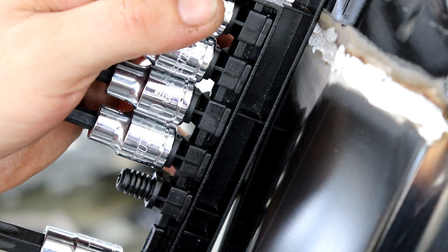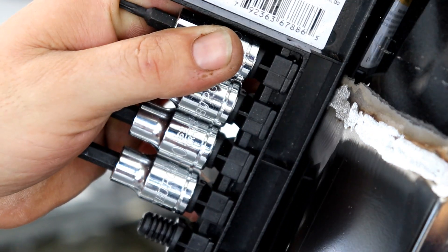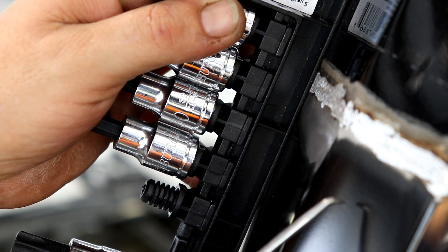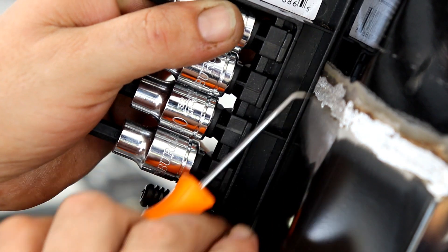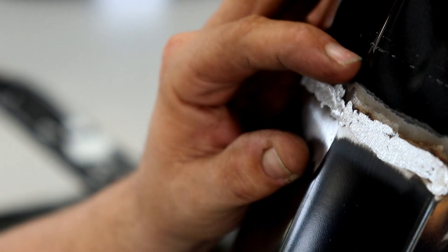Look how flat and smooth that is — that's what we're going for. This pick would get stuck if it couldn't just slip right over everything, and you don't see that pick bouncing around — it is perfectly flat. We're not gonna cake this with Bondo; we're gonna put a little bitty cover right here just to cover the transitions. If you're a little more precise in your cuts, you're gonna save yourself so much time in body work later. Very precise cuts, very precise welds, keep your temperature cool — weld hot. A lot of heat in that weld but over a very short period of time. It just really burns it all together and locks it in.